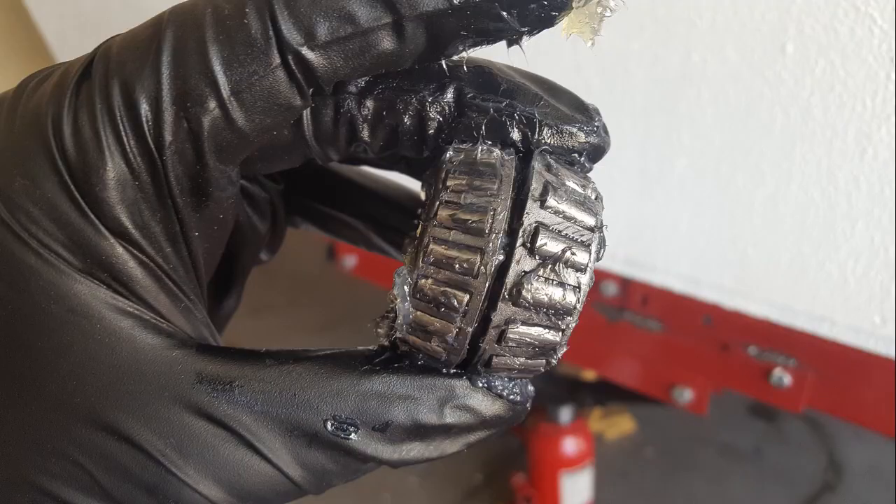There's still so much to do. I'm having an issue with the bearings. Some of you saw that I mated the bearing from an aftermarket hub with a bearing from the Harbor Freight hub to try to get rid of a lot of play that I could not get out, even if I tightened that axle nut all the way. I was able to tighten it to where you couldn't move the wheel and back it off until it was free with no play. But after driving it around for a little bit, if I rotate the axle nut one turn to get to the next hole for the cotter pin, it becomes too tight. If I come back just one spot on the castle nut to get the cotter pin in, then I get play.